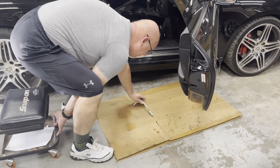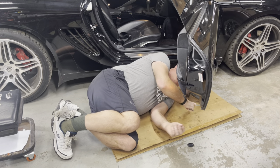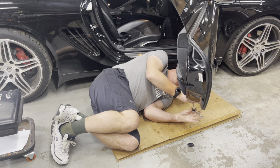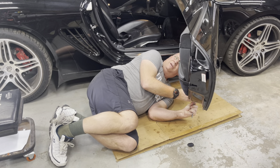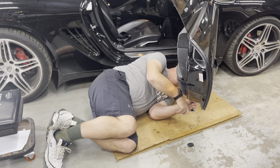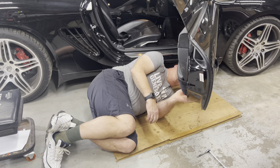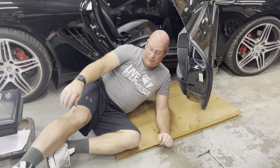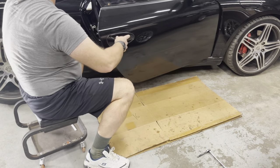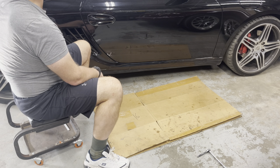Open the door back up and crawl on down here. The plug is really easy to pull off. Loosen the nut with a 10-millimeter wrench. If you watch the glass, see how I'm moving it? It moves a lot. I now have it all the way in. Reinstall the plug and make sure all that plug's seated. Get my paper — it's pretty tight. I can still pull it out, but it's a hard pull.